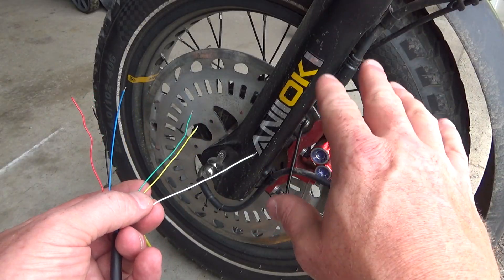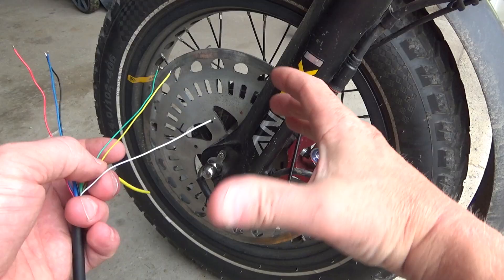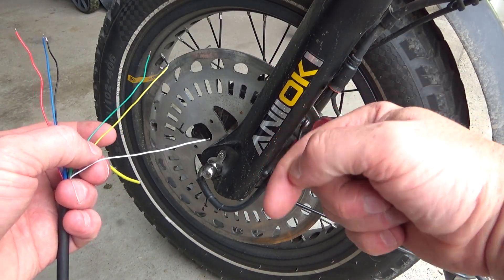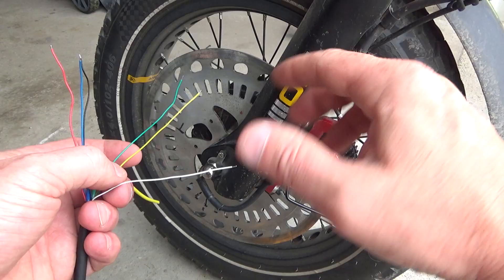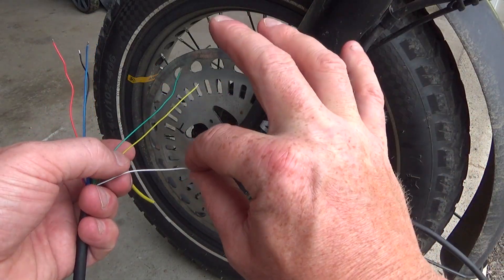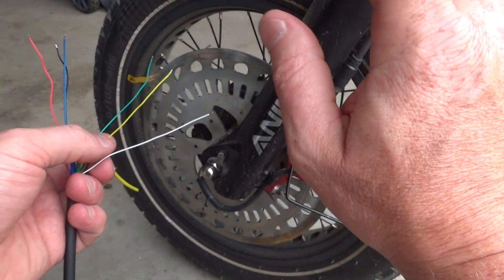What is the speed sensor? It's also a hall sensor in the middle of the motor, and it reads how many revolutions your motor did — basically how fast per second — and that's used to calculate your wheel speed. It's active for the rear wheel on our bikes and not active for the front wheel.